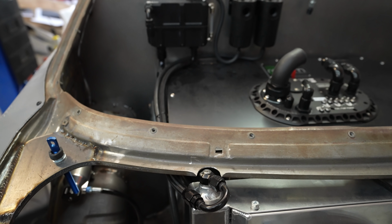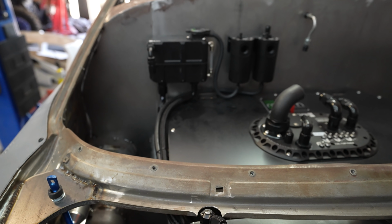We had an aeration problem. We couldn't get it bled. Yeah, we always had problems getting it bled. That's the word. But the water was essentially moving too fast because of the -20 lines. So with the R34, we went to -16. Really, on any of these cars, just -16 if you're gonna do it.